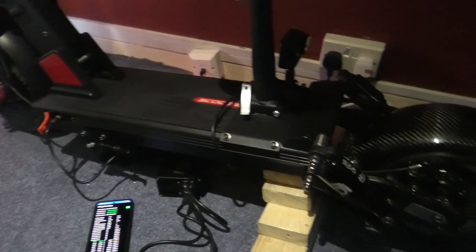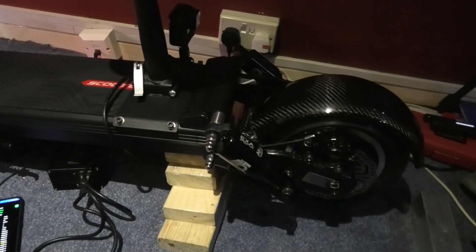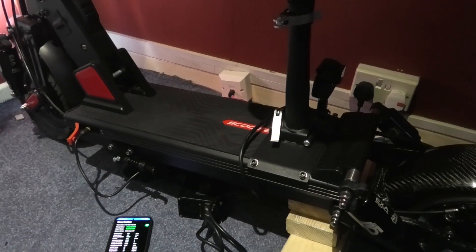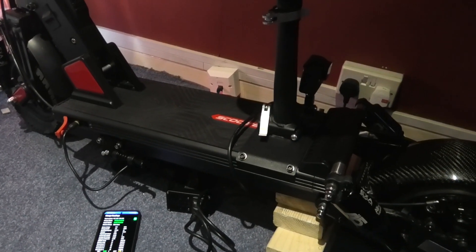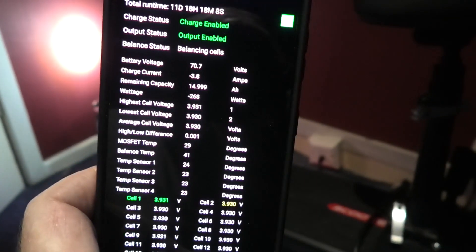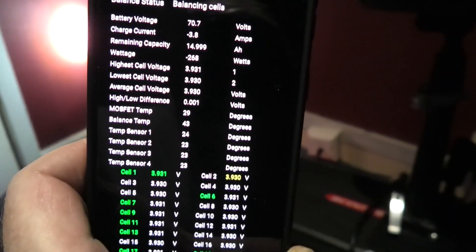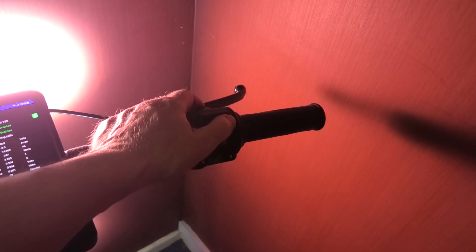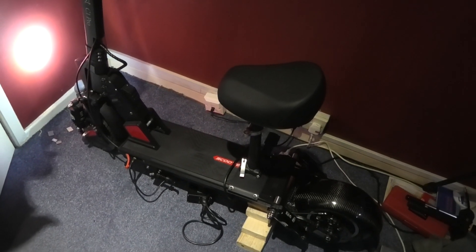Because I don't sleep it's now 3am in the morning. I can't sleep for more than a couple of hours because my leg keeps saying hello - god, does my head in. Anyway, I am up charging the scooter. We're at 70.7 volts charging at nearly 4 amps - that's going to go up to 75.6 volts so we've got quite a way to go. This goes here and this elastic band goes through these holes here and keeps that in place perfectly. I've got my headlights - so when the day comes, I'm going out.